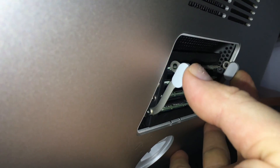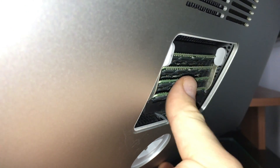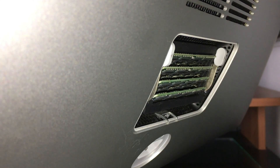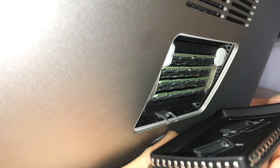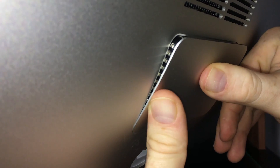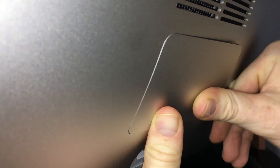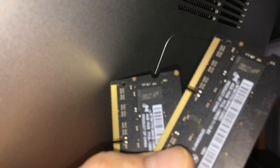That's all we have to do. We pressed it out and now we have to press it back in. The very last step is just putting this cover back on — it goes in this way. And there we go. That's how you change your RAM — that's how you guys can switch up your RAM for your Mac. It's pretty easy. All you guys have to do is turn on your Mac; everything should work right away. There's no setup for RAM — it should detect it and it should be all good.